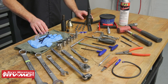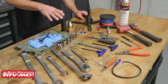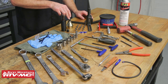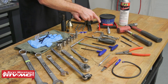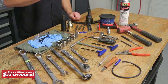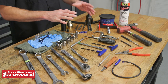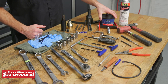To do this job you're going to need some safety glasses, rubber gloves, and some rags. Tools you can't do the job without are your flywheel puller, we have a primary drive gear puller, crankcase splitter, and your flywheel holding tool. If you need any of these special tools be sure to get those on our website. I also recommend using a gear jammer. The rest of this stuff is really going to be common hand tools and some contact cleaner along with some grease.